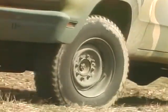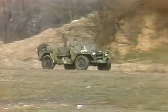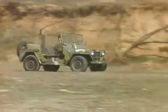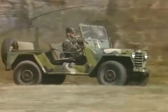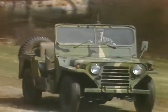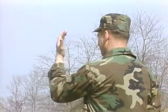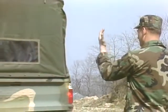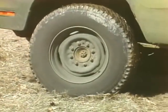The engine will get a wheeled vehicle rolling, but it takes brakes to stop it. In today's Army, hydraulic brake systems are common. And among those, the ones you are likely to see most often are the drum brake systems used on M151s, the quarter-ton 4x4 utility vehicle the Army has so many of. But there's also another type you need to know about. The M880 one-and-a-quarter-ton cargo truck uses drum brakes in the rear, but up front it has a disc brake system.